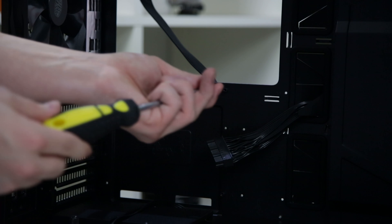Installing the motherboard is nice and simple. With the rear I/O shield and standoffs in place, put it in at a slight angle - slide the rear I/O connector in first and then tilt it down. On this case the central standoffs are slightly extruded so you can hang the board on them without screwing it in immediately, although you will need all nine screws to get it safely secured. With the motherboard installed, we'll connect up the fan here and then install the water cooler in the top.